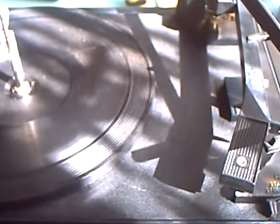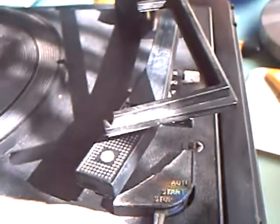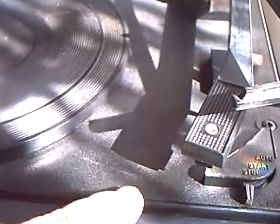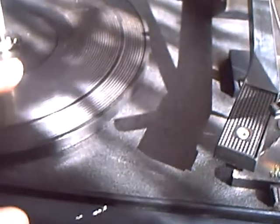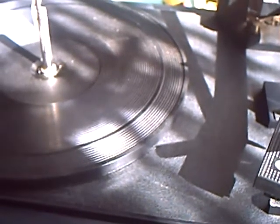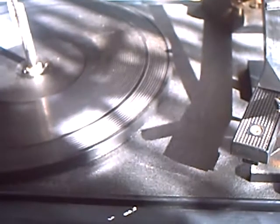Apart from that, the only things it's needed is a bit of adjustment for the tonearm, because it was setting down just off the edge of the record and cutting out too early. We've now got it going so it hits the edge of an LP more or less bang on, and turns off when it should. And of course the usual BSR gunge, which is what you expect with this sort of thing.